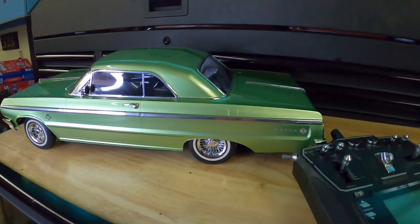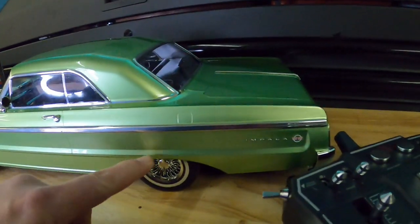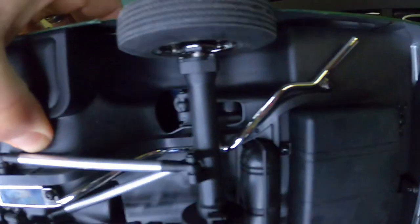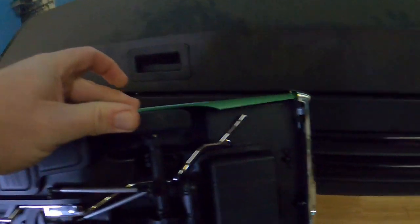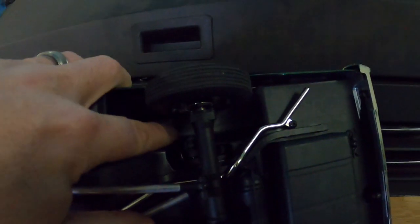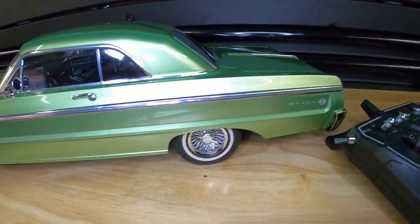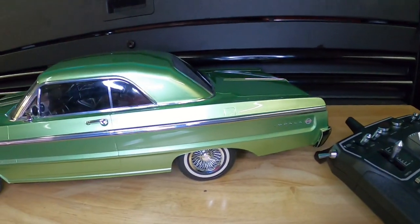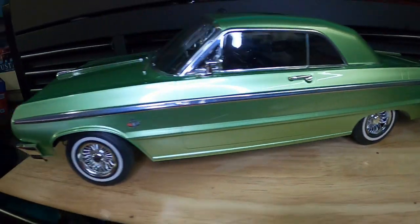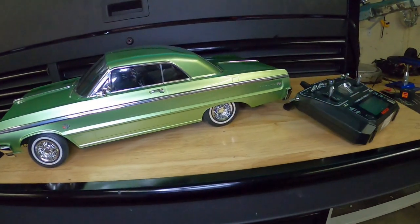However, straight out of the box, you hit the three-wheel motion on this bad boy and you drop it all the way down, and the other side's tilted up — this rubs inside the chassis. See inside the chassis there? See the wheel well in there? That tire will bottom out at an angle. Right around in here you really need to cut that out. Or you could set the end points on the servo to not drop as far in the back, but then what is the fun in that? You want these things as low as possible. I've seen people body dropping them and getting them even lower. That is definitely a flaw because that back wheel catches, and when you turn to go either way in three-wheel motion, it won't — it'll go straight or it'll even pull the opposite way. So that's definitely a flaw.